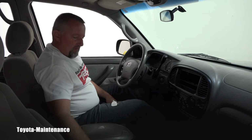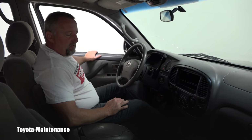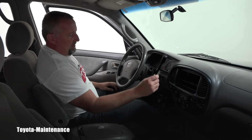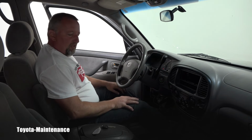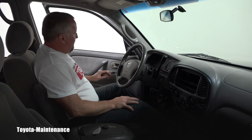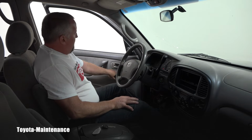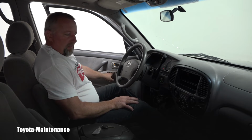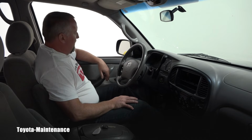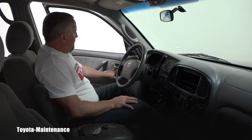So you basically close all the doors on this vehicle. Everything is closed. Now I open the driver's door. I put a key in the ignition and pull it out. I will press the door lock switch 5 times to lock and unlock at 1 second intervals. I will close the driver's door and open it again. I will repeat the same thing 5 times.